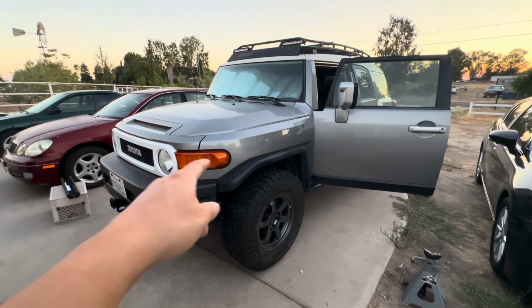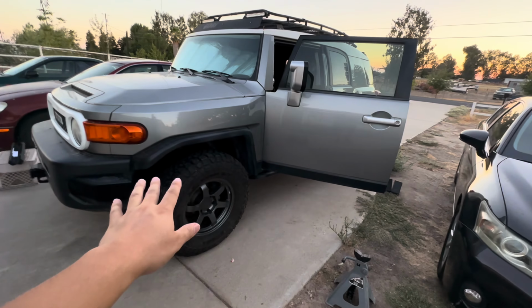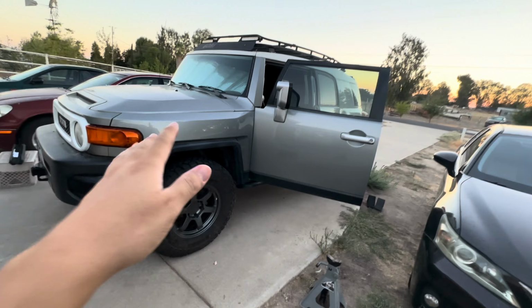All right guys, I got the wheel on and nothing else, just the wheel. But we're gonna go ahead and take it for a test drive right now. So hopefully it's good. Everything still sounds good today. I started it up, it fired right up, and still no check engine light. The idle is smooth. It doesn't feel jerky. Before it was like that, and now it feels good. Still worried, you know, every time you fix a car, you're scared that the issue or some new issue will pop up. But so far everything is still good. So let's go for a test drive.